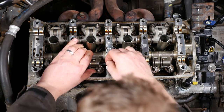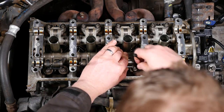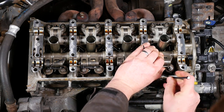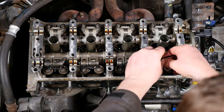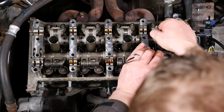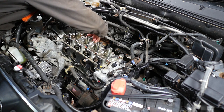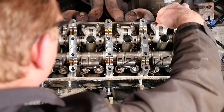I'll speed up cylinders two and three. You can clearly see what I'm doing on cylinder number four — just popping them both up, very carefully putting the cable tie underneath and tying it down, making sure that neither of them move up as you tighten it. And the exhaust cam followers at the back — they're all one piece. I'm also going to confirm that every cylinder has the same one, just in case one was different.